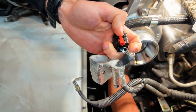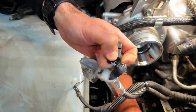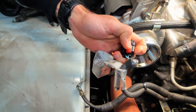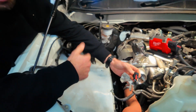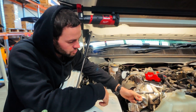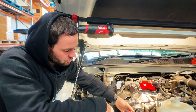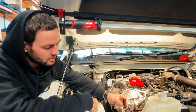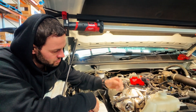You won't be able to get the plug out until you push the locking tab back. They're usually red or yellow, so if you see one on a plug, it's most likely a locking tab — just pull that back and you'll be able to pull the plug off. Be careful not to damage that plug, because you need it to connect to the new alternator.